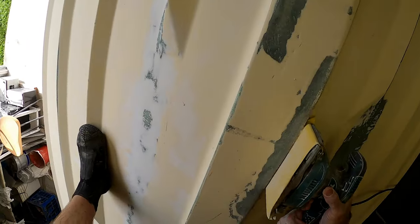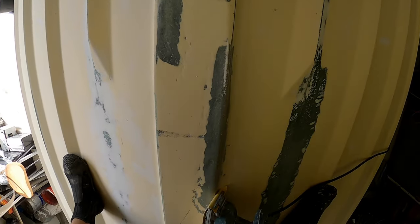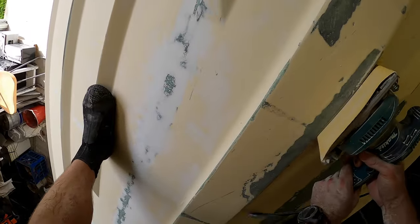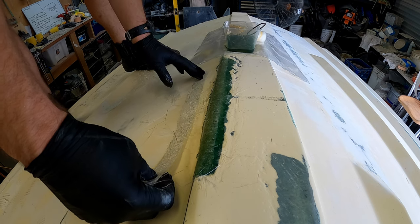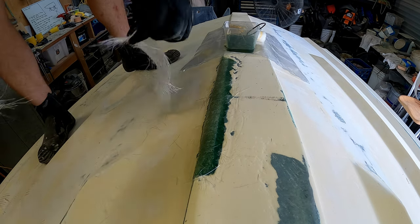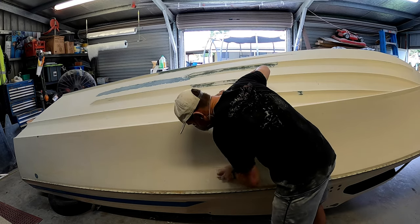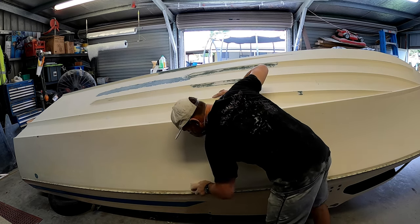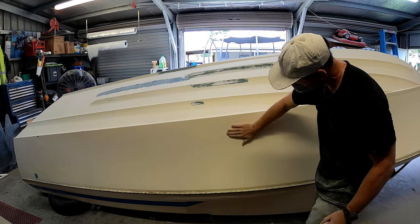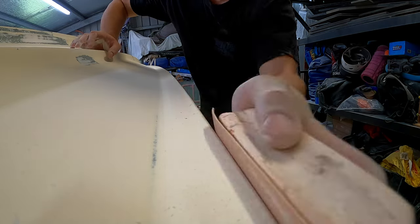Now I was able to fully attack the bottom of the boat — so much easier, way easier than laying on my back trying to do it. Like I was saying with the fairing, I didn't want big thick bits of fairing anywhere, so anywhere I needed to add glass, I added glass. You can see me adding a little bit there on the edge of that planing strake. I basically walked through sanding multiple times — every time I'd find something, I'd circle it with a pencil and go back and pay a bit more attention there. I did that probably three or four times around the whole boat — sanded, found spots, filled it, sanded — and I kept doing that until I got the bottom and sides of the boat to a point where I thought they were pretty good and ready for gel coat.